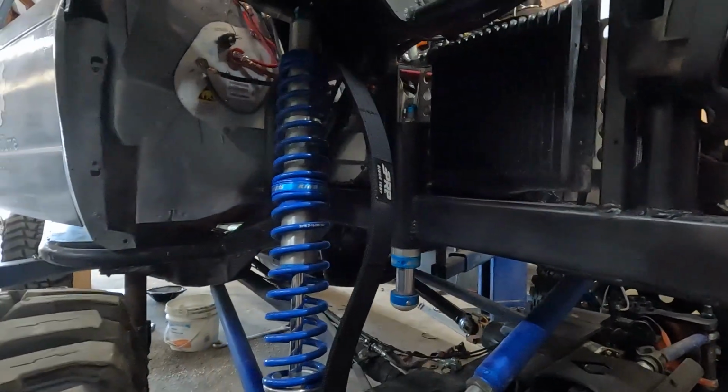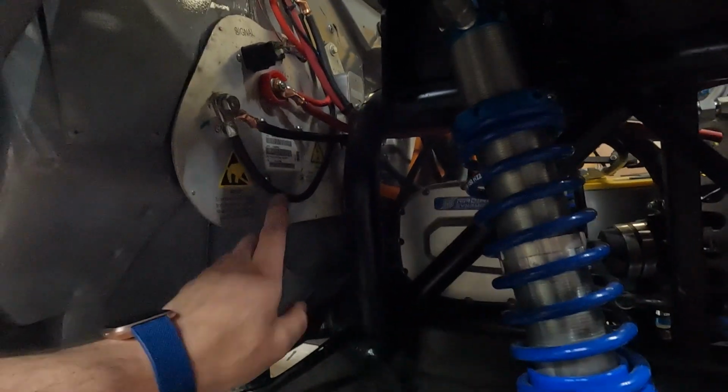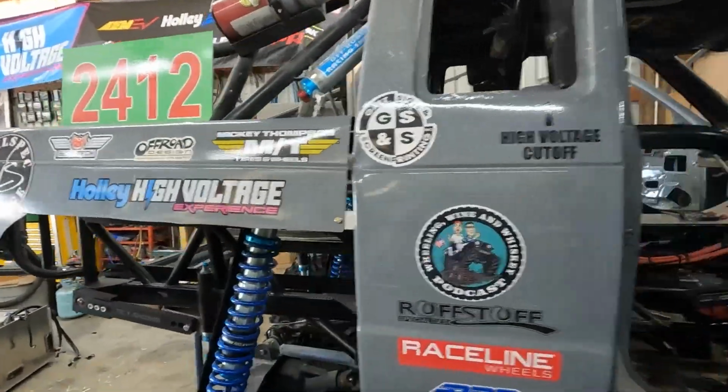But yeah, all kinds of goodies. Oh yeah, there's that pump again. Yep, there's a steering pump. There's your DC-DC there, which is out of the Tesla, too. Oh, you were able to repurpose that? Yeah. We ran one 12-volt wire and just turned the enable on it.